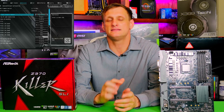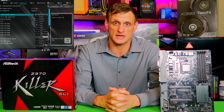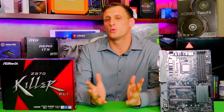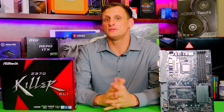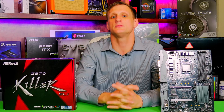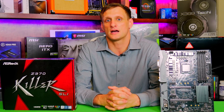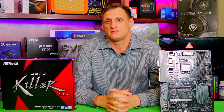Another option is a per-PCIe slot speed or generation setting, so you can go through all the PCIe slots, including the x1 slots, and set them to PCIe Gen 1, 2, or 3 — which tells me we're already way ahead of the game compared to some other motherboard manufacturers for mining. If you were going to mine on this motherboard right now, the cheapest processor you can go with would be the i3-8100. I'm pretty confident this will get the job done. If ASRock's own BTC Plus motherboard is available, go ahead and grab that, but currently it's out of stock pretty much everywhere, and if it does come in stock you're looking at spending over $200, which seems counterintuitive.